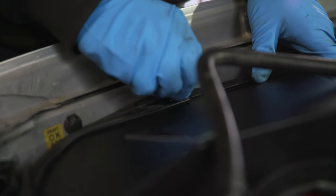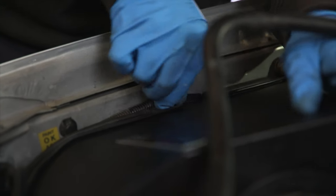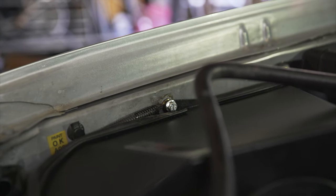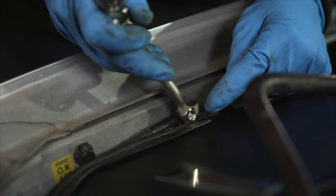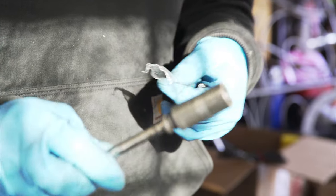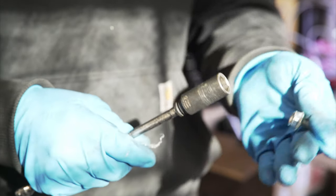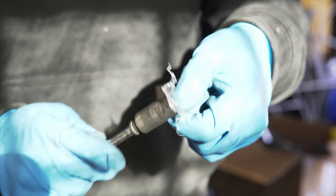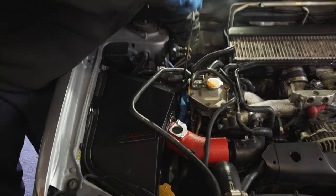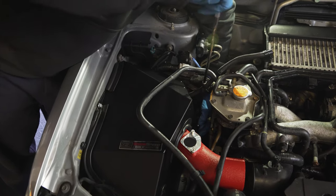Starting up top — I like to start this bolt first because it can be a little finicky. You also don't want the ground strap to fall into the intake after you've already put the other two bolts in, so you've got to work that on carefully because it's a sealed system. Once you get the bolts in there and started, just tighten it down. Next, grab a 13 mil socket and put the bolts in to hold the shield down. A little trick: grab a piece of plastic, shove it in your socket and wedge the bolt on down so it doesn't fall out. There are two bolt holes to hold the shield down, so three fasteners in total securing the whole shield.